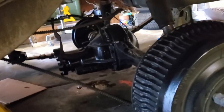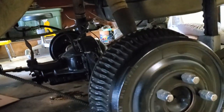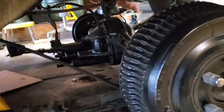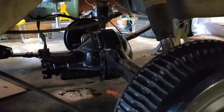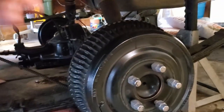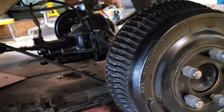Here is the rear end — it's an eight-and-three-quarter with 3.23 gears, an open diff, and 11-inch drum brakes. This rear end came out of a '68 Coronet R/T that unfortunately burned to the ground. The guy sold it to me pretty cheap and warned me the seals might be damaged from the fire — and of course they are, because it leaks. But I needed it in the car because the eight-and-a-quarter that was in here was making noise. What I'm going to do with the rear end is work with Eaton — they're gonna send me a TrueTrack unit — and I'm probably going to build a 3.55 or 3.73 gear set depending on the powertrain I go with.